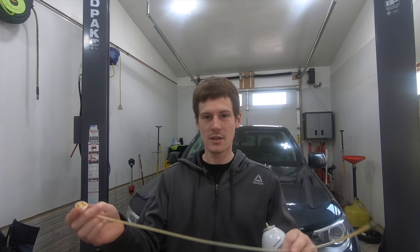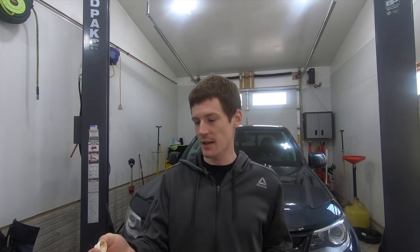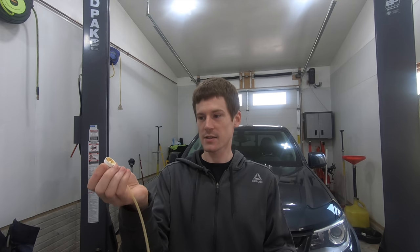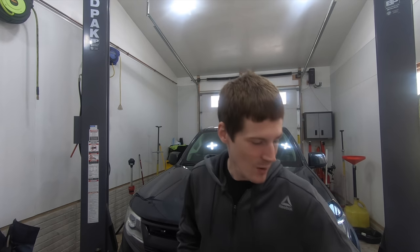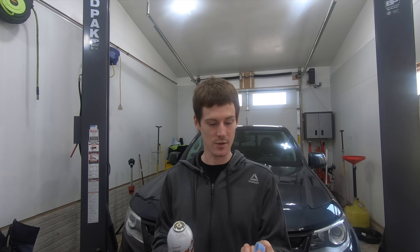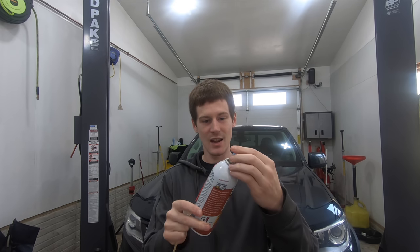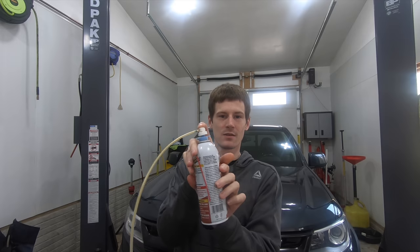Next I want to talk briefly about the inner cavity wand for the aerosol cans. As I mentioned back in July, the traditional Fluid Film and Wool Wax inner cavity wand does not work with the Surface Shield cans. One of the great things about comment sections is people smarter than me suggested graffiti adapters. I bought some and they work fantastic — I'll link them in the description. They take a male can and convert it to a female, so the wand fits. This works now.